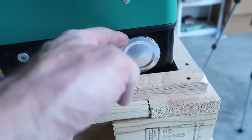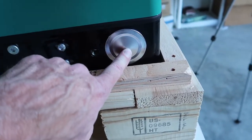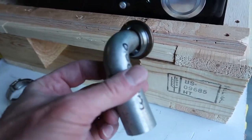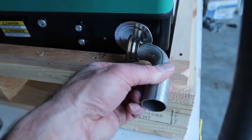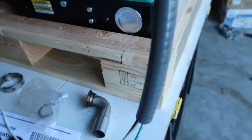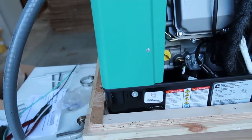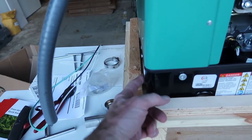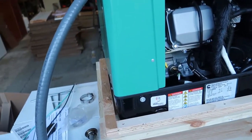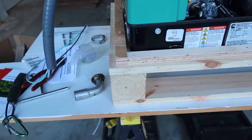See this big silver cap? You can pop that cap out. In certain applications where you'd want the exhaust running out the side, you can run it out the side — you mount it inside like that. For down exhaust, it would mount like this. I would think that probably most applications would use a downward facing exhaust. Probably the only time you'd have a side exit exhaust is maybe if the generator was mounted in a small motorhome like a Class B, where you wouldn't have much clearance underneath and you wouldn't want to reduce your ground clearance. And then of course your tailpipe and everything.